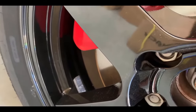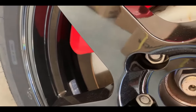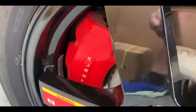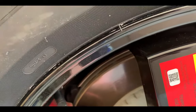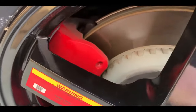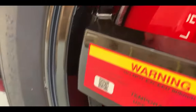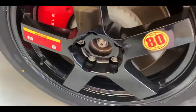This particular wheel is balanced and has weights on. We're going to move the car forward and show you what happens with the wheel weights - they actually do clear the calipers. Moving the car forward slowly, you can see the clearance - it's tight but does not hit the larger calipers. As mentioned, these calipers are the same on the Model 3 Performance and Model Y, so you can confirm the spare fits both models.